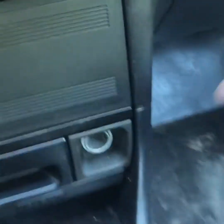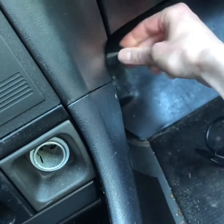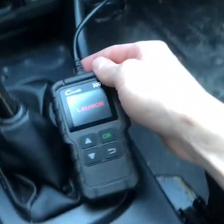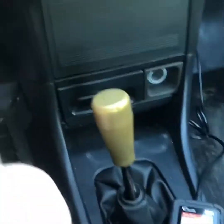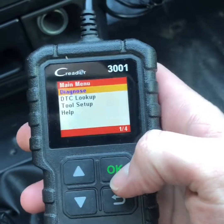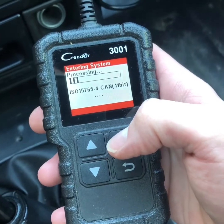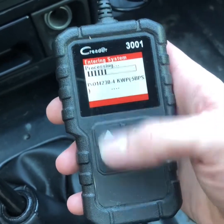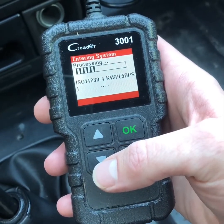I just reset the battery, which reset the codes. I probably could have cleared the codes with the scanner, but I'm going to pretend that this is some random person on Craigslist that reset the codes and didn't have a scanner to do that — so they just reset the battery. So here's what happened: I turn the key, we'll go Diagnose. I just reset the battery, I unplugged it and plugged it back in. I'm willing to bet it's going to say Incomplete on a lot of those processes that it normally reads through and scans.